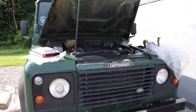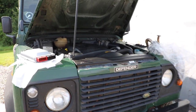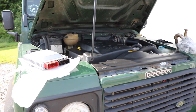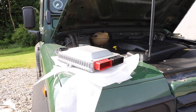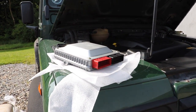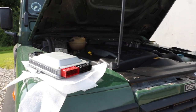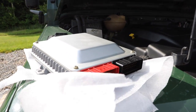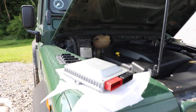Before I get out on the road, I just want to do a quick run through of the changes that have actually been made to the car in order to allow it to operate with this stage two remap. We have the TD5 engine up here producing 122 horsepower from stock in the Defender, and 136 from stock in the Discovery, but it should now be making around 180 to 190 horsepower thanks to this little box here — the ECU or engine control unit. If the engine is the heart of the car, this is effectively the brain. This old ECU is identical to the new one apart from the Storm Tuning branding across the top.